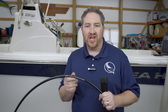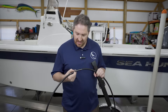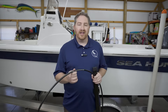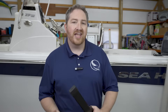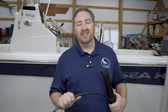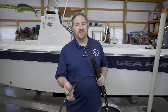While we're looking at the number on the cable jacket, this is a good time to talk about how to identify the correct length of cable for your boat, because the cable number actually contains the length in the number itself. The last two digits, in most cases, are going to be the length of the cable in feet. This goes for whether you have a Teleflex cable, C-Star Solutions, Dometic, or even U-Flex — they all list the cable series and those last two digits are the cable length in feet. Now, some of you might have an older Morse style cable. These cables had a red jacket and haven't been made in many, many years, but there are still a few out there. If you're replacing a Morse cable, note that the number on the jacket is actually the length in inches — so make sure you know about that difference.